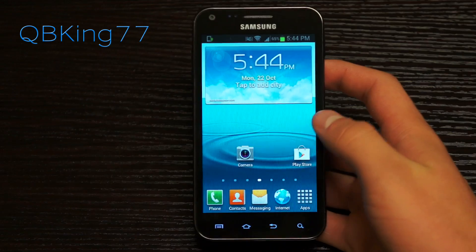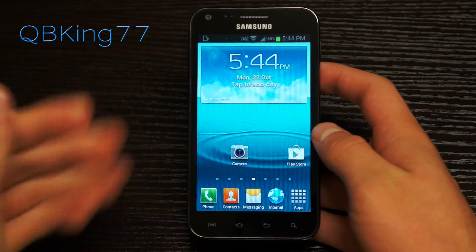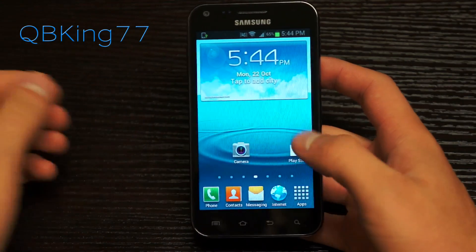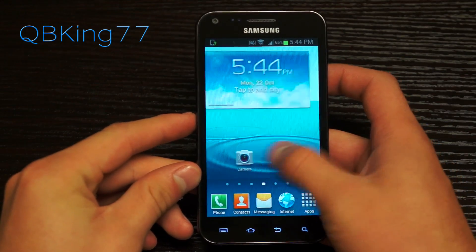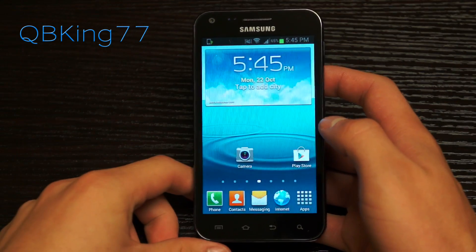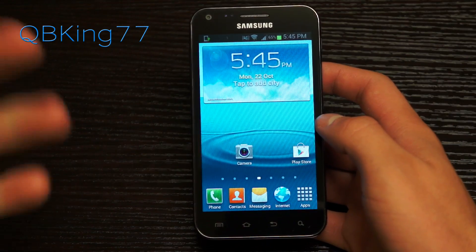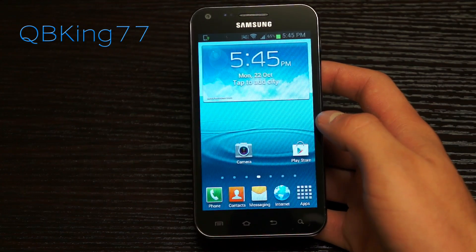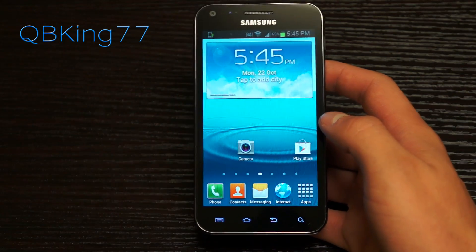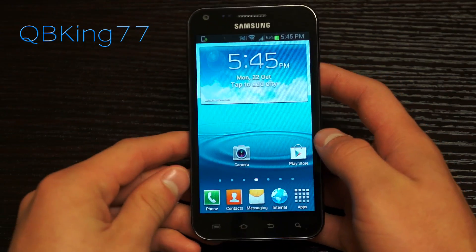FJ10 is the version it is, and it's just kind of an indicator that Samsung is working on a Jelly Bean update for your Epic 4G Touch. I do want to go over it and show you some of the features of the update. 3G does not work, and other various things don't work as well — as I said, it's a completely alpha build, so I do not recommend installing it. I can post a link in the description if you'd like, but again I don't recommend it. If you do want to install it, you'll have to put the CSC file in the CSC slot of Odin, and then the other file in the PDA slot of Odin — but don't do that unless you know what you're doing.